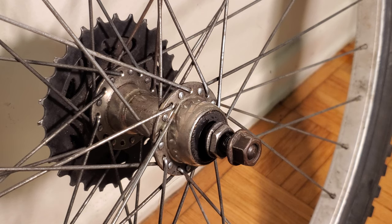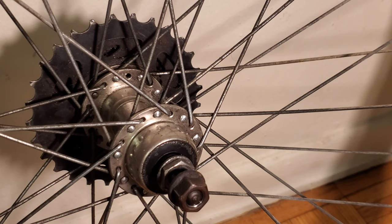If you take a look at this flange, you'll notice a pattern with how these spokes connect up to it. This spoke right here has the elbow on the outside, where the one after it — all we can see is the end of the spoke — because the elbow is on the inside of the flange. The next one has it on the outside, the one after that has it on the inside, and that pattern continues all the way around the wheel. That empty hole over on the other flange is where my broken spoke used to be connected. Based on the pattern, since the spokes on either side of that hole have the elbow on the outside, the new spoke will need to be inserted so that the elbow ends up on the inside.